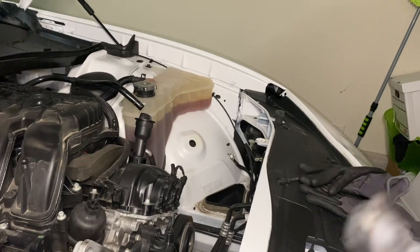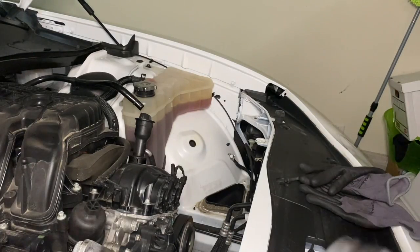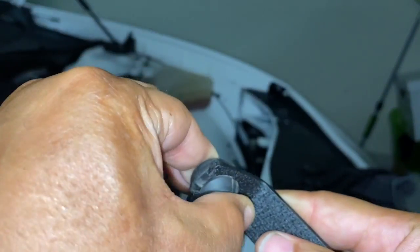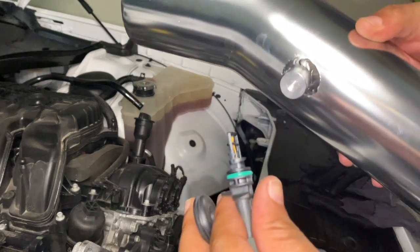All right, so here's the grommet on the new aftermarket bracket. As you can see, you want to install it with the little crosshairs pointing up towards the top of the bracket, with that flat piece going down. That part will stick on the little rod that sticks up off the engine.